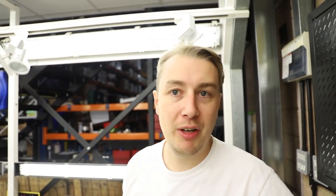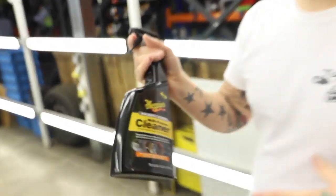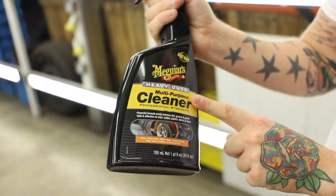So what would you suggest next if you've dry-washed the car? We've dry-washed it like we normally do. As you've seen in the bay, sometimes people just want to get straight in — it's raining outside and a lot of the cars that come in are show cars. So what we try and show them is how to safely wash using products that aren't a bucket, grit guard, wash mitt, and hose. Because it is horrible out there, we are using the multi-purpose cleaner just on the lower surfaces — it's one of our newest products and it's great for degreasing, removing hardened grime from seals, inner arches, wheels, and tyres.